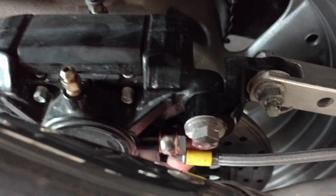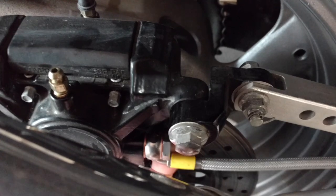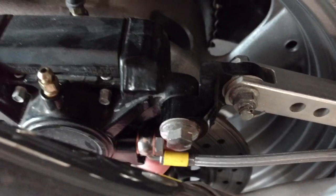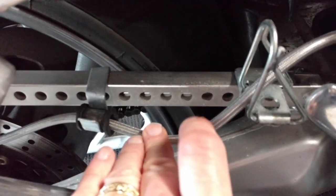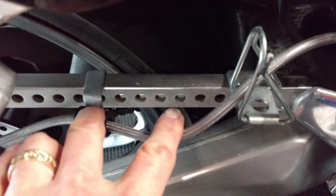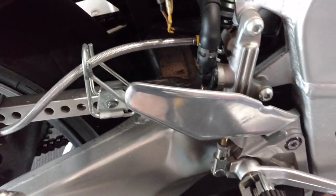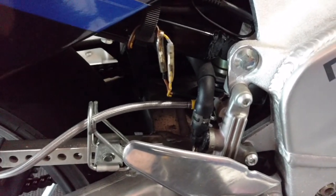Here's the rear line fitted. I was worried that it wouldn't contact the little bump that sticks out to keep it from rotating as you tighten, but it does — so that's great. Once I get that snugged up it should be in the right position. I'm a little concerned about this though: the grommets are loose because these lines aren't nearly as big and don't have a thick rubber coating. I'm probably going to just add zip ties crossed over this to hold it in place and make sure it doesn't pop out.